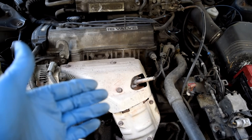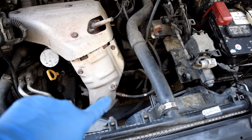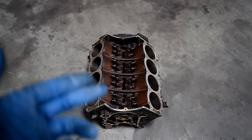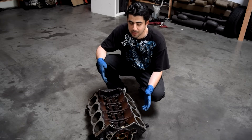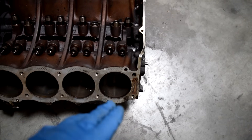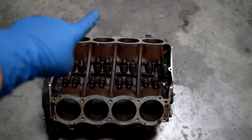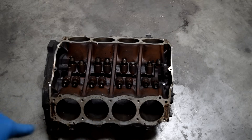If you have a check engine light on a four-cylinder, the fault codes would be bank one sensor one or bank one sensor two, since there's only one bank. On a V6 or V8, the bank containing cylinder number one is bank one, and the other side is bank two. Cylinder number one is always the one closest to your timing chain or timing belt. On this engine, that determines bank one, and from there you can identify sensor one and sensor two on each bank.